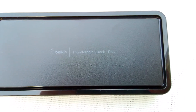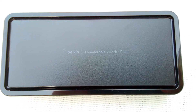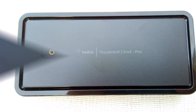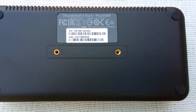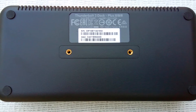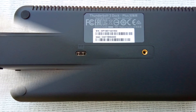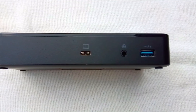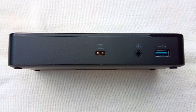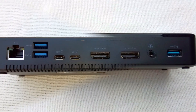The dock also has enough power for external storage, two 4K monitors, and a MacBook Air trackball dongle. The grounded power cable is 6 feet long for easy access to an outlet. On the back of the dock are two DisplayPort 1.4 ports that can drive dual 4K HD monitors at 60 Hz or one 8K monitor at 30 Hz. The dock lets you mirror monitors or have screens extended with different things on each display. If HDMI is needed, use inexpensive DisplayPort to HDMI converter cables.